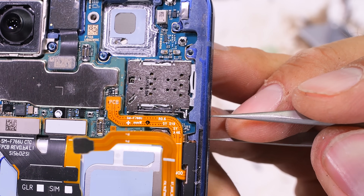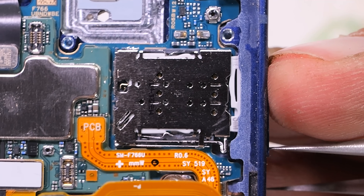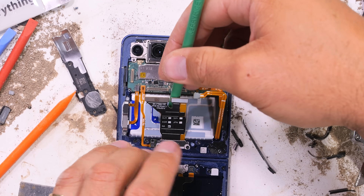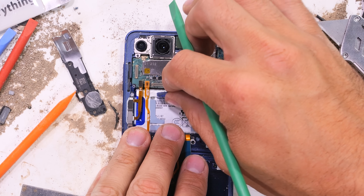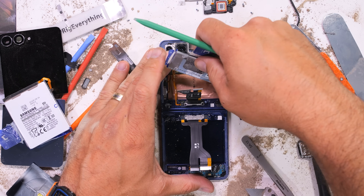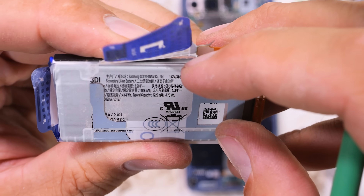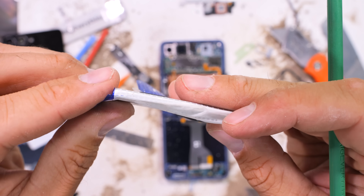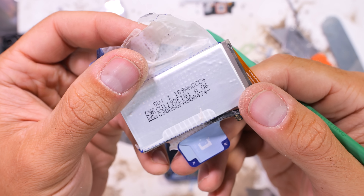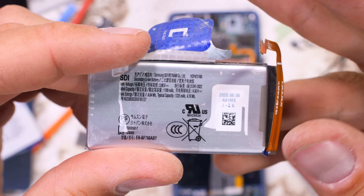Moving up the phone, we have the SIM card tray near the motherboard, and with the screen off you can see how that little hole presses on a lever which pushes the SIM card tray up from the bottom — kind of cool to see that for the first time. I'll unplug a few more ribbon cables just like little Legos, going to the power buttons and lower half of the phone. The upper battery is definitely the smaller of the two but pulls out just as easily. It's interesting that both batteries say secondary. With the smaller battery at 1225 mAh, we get a total of 4300 mAh.